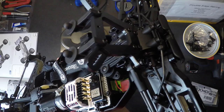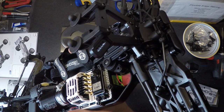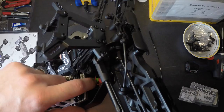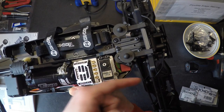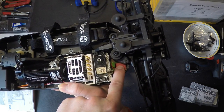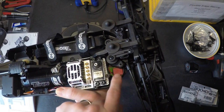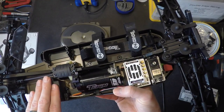To mount it up front, I've got a piece of angled lexan — in bright green so you can see it — cut from the side of an old two-wheel drive buggy body to get that 90-degree angle. I super glue it to the side of the servo and to a ridge on the edge brace, giving me two glued sides, and then I just double-stick tape the transponder down. Note this only works with small transponders like the RC4 and RC4 hybrids from MyLaps — if you have a larger one, there isn't enough space and you'll have to put it in the back.